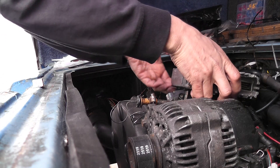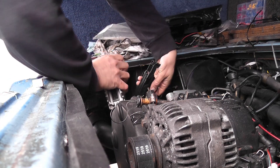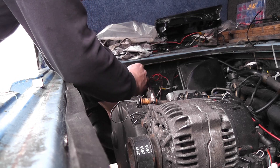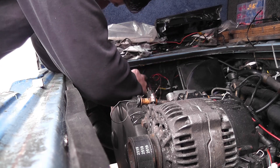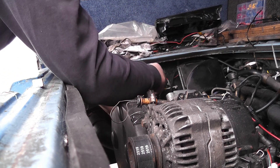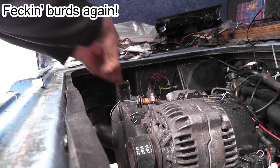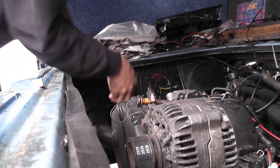I'm just going to plug in the ECU here now. So it's a big 68-pin plug. I'll pop the ECU into where it goes — the wiring is all separate that way. Pull it all the way up and then line up your notches. They don't make it all that easy to be honest. As you push that down it just pulls all the pins in. That's in now.